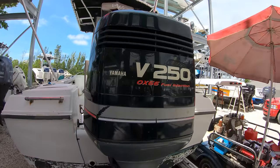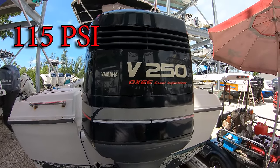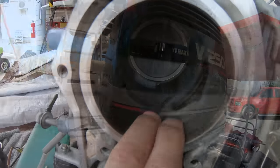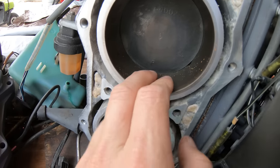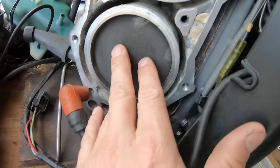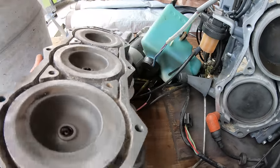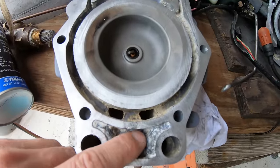Now if you see that most of the cylinders are at 115 psi and one cylinder is down at 85 psi, that is a problem. Depending on the age and wear of the engine, there could be issues with the piston rings being worn out, and you will want to dig a little deeper into why that cylinder is that low. Running it for too long like that could end up blowing up that piston and destroying the engine.